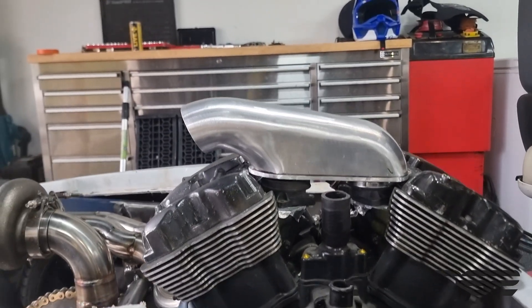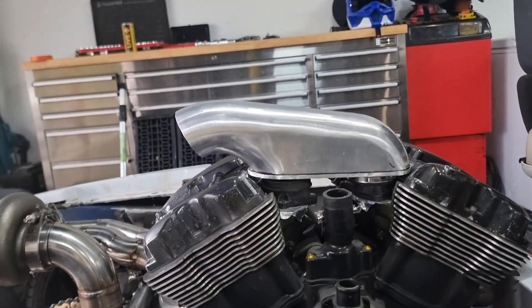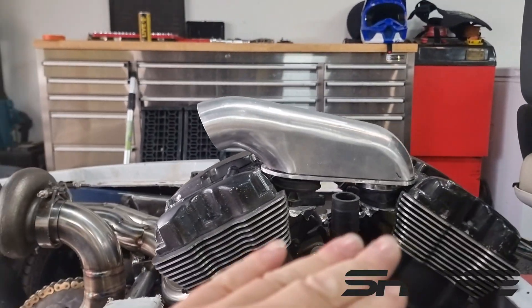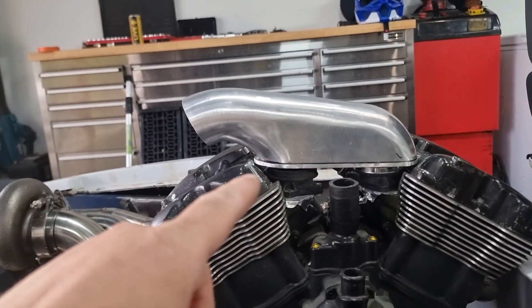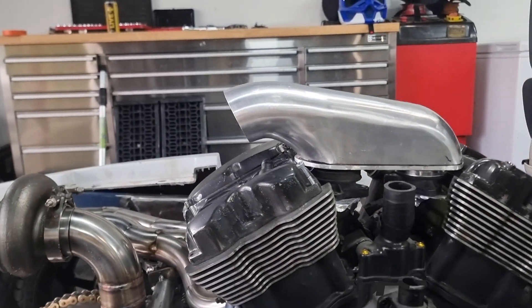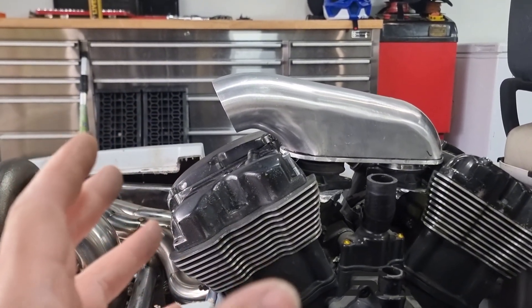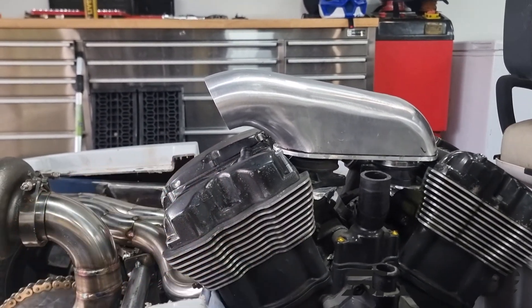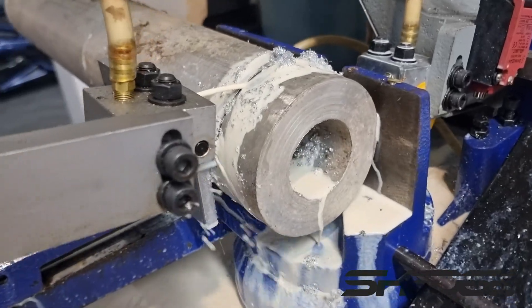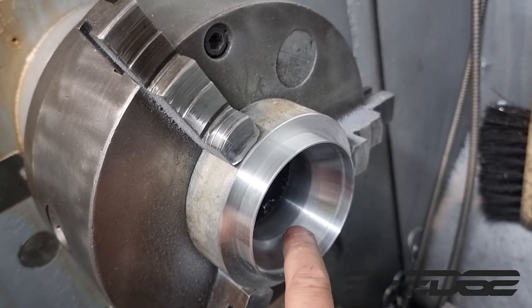We've roughed out the base plate so now we can see how the plenum is going to sit roughly. We've cut some out of the bottom so it sits on more of an angle going backwards - just looks a bit nicer that way. Also cut some excessive material off the front. That's basically how the plenum is going to sit, slightly higher once we figure out how to adapt it from the plenum to the block. What's next: we've got to machine up an adapter to hold the drive-by-wire, and also machine an adapter to go from the drive-by-wire to the wiggins ferrule.